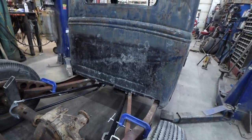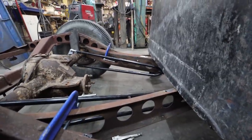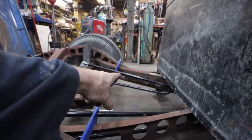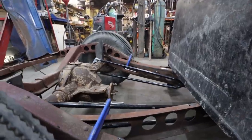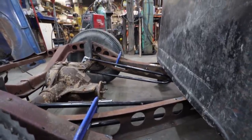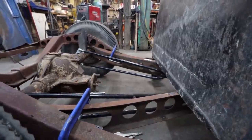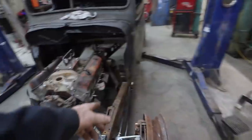And the cab is hitting on the X-frame bracket there, because now it's higher than the cab. But I could narrow it up and pinch it up into the rails to get it all back to original where it should be, even though everything's been shuffled back. So that's kind of the plan. We'll have to either pie cut these and then kind of split this X-frame back. And then up in the front, we'll do the same. Pinch these out, but some of the material that I had kept, I'll be able to use to box the front part of the frame.